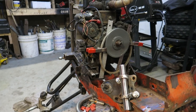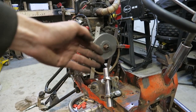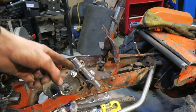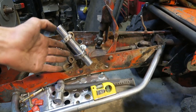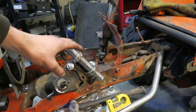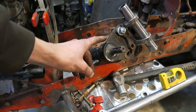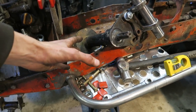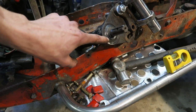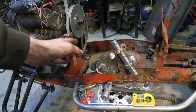Starting to get some more work in here. I got my two flat rulers on the back side of my pulley, held on with a couple little clamps so I know where the back side is and both sides need to be flush up against there. You might be looking at this going, 'What the hell, Riley, you pull that out of the junkyard?' Yes, we did. Because we're on the driveline situation, I figured why not use more driveline parts. It will bolt into two of my holes and I can drill out the third if I need to. I welded in a chunk of DOM tubing, tossed her in the lathe, turned her down, and that will get welded onto the frame so I can unbolt the whole setup. I took this apart, looked inside — I can replace two bearings in here, which is nice, and they work great. It also has a grease nipple on the back side. I got rid of the shaft play by adding some machined washers in there. Next I'm going to weld this onto the frame and get the alignment perfect or very close to it.